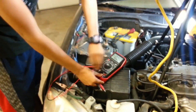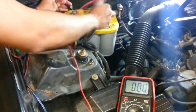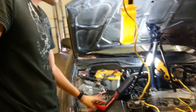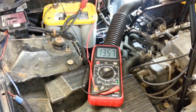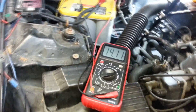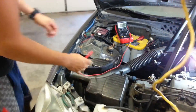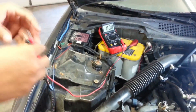If we test it right here, you should see the battery is charged at roughly 12 volts. It's at 12.3. When you start the car, in order to charge the battery, you should see it go up to about 13 volts. As you can tell, it's at 14 volts. So the battery is being charged by the alternator. Now that we know that the alternator is charging the battery, we move on.